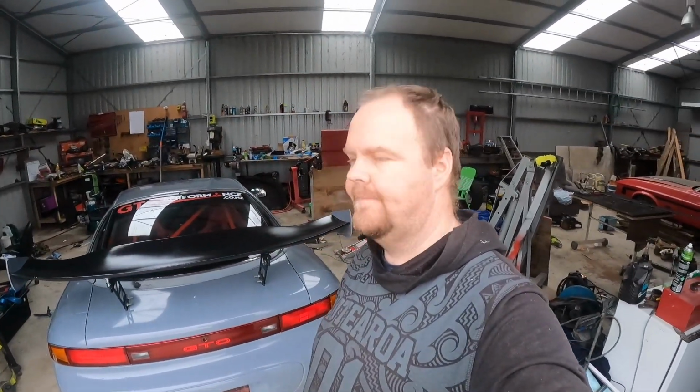From the small bit of research I've done, the same size compressor on a Garrett turbo is rated to about 525 flywheel horsepower, and as a rough calculation this car is at about 480 flywheel horsepower, pretty much with a cheap Chinese poorly designed turbo. So it's very likely that that always was my restricting factor, the compressor wheel. But it could also be maybe my plenum, although I've talked to a couple of people and they both have agreed that the plenum shouldn't be a problem, purely for the fact that it's got quite a small volume. But they said that on wide open throttle that shouldn't be too much of a problem.